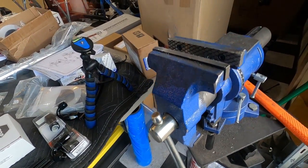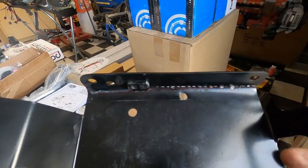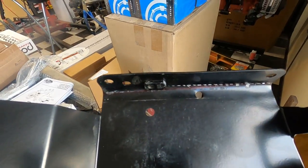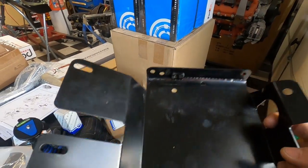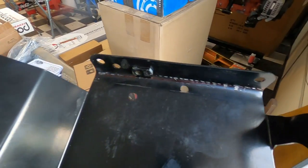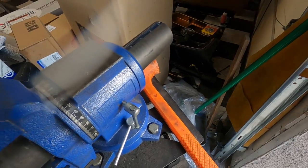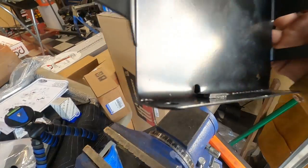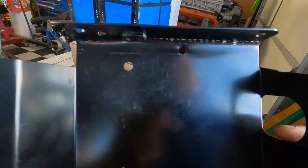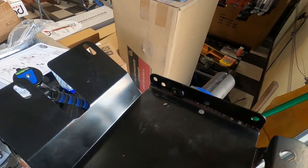I made a line with a sharpie — right at the built-in welded nuts that Vintage Air puts on from the factory — on both the top and bottom sides, because that's where these guys mount on the firewall. The purpose is to mount this thing without any bolts going through the firewall. So we creased it there on both sides, just hit it with a hammer and worked it. It's not going to be perfect, but I feel like it's definitely going to work.